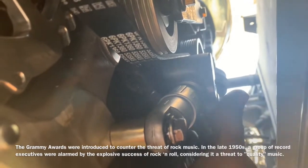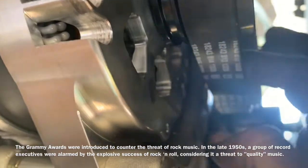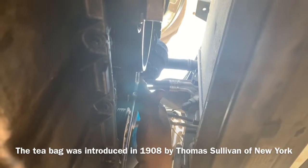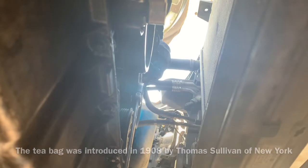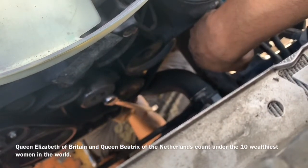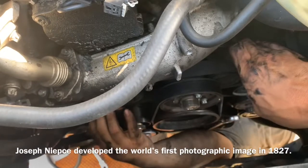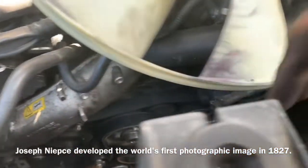Taking your hand and pushing up on the tensioner will release its shock lock, then your alternator belt will be tight and secure. Grabbing a 17 millimeter we're going to reattach the main belt and set the serpentine tension. If you've taken the belt and only left it off of that pump, you can push it on and release the tension on the tensioner. Taking your fingertips and making sure that your belt is on all of your pulleys and centered in them is a good recommendation.